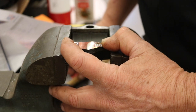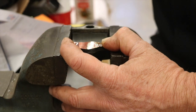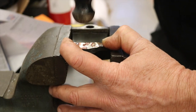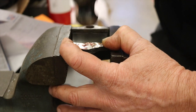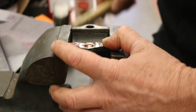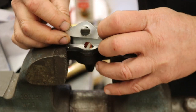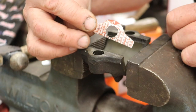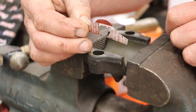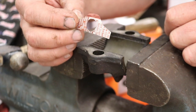We're going to knock a hole in the shim by using the cap and the ball end of our ball-peen hammer, by lightly tapping the area of the hole. It cuts the sharp edge right out of our shim. See, it cuts a nice perfect hole in our mug root beer can, and that'll be a good shim for us to use. I'm going to make one more, put it in, and see what the clearance is.